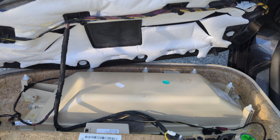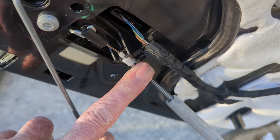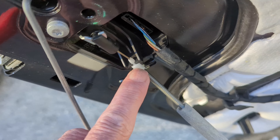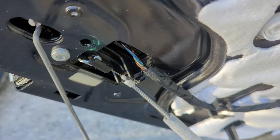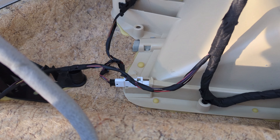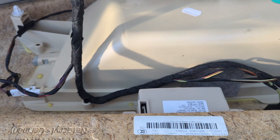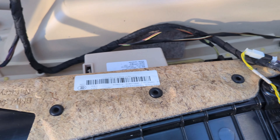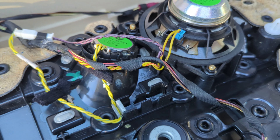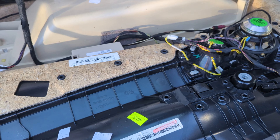It's loose but there's a ton of wires in here. Come over here — this is your door handle cable, you can see it goes in that little slot. Pull down on it and it'll come out of that slot, then unhook it at the top. You've got to go around and find all the wires — you have speakers, lights, all kinds of stuff. BMW connectors only fit in one place, so you can't plug things in the wrong spot. Unplug everything and get everything loose.